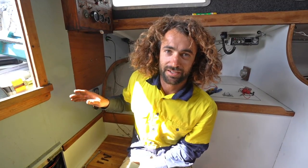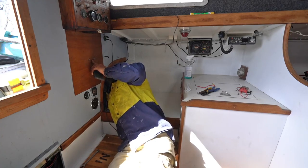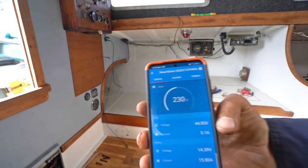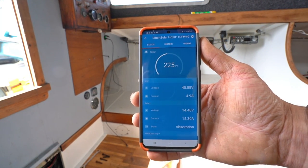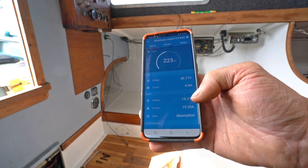We'll just go under and flick the breaker on, so we'll have charge going to the batteries and then we can hook our phone up to the controller and see how it's working. I've flicked the breaker on but I'm not sure what's happened — let's connect to it and find out. I've connected to the charge controller — it shows you how many watts are coming in. It's pretty much full sunlight with a bit of cloud around, and we're reading about 227 watts. It tells you the voltage from the solar and the voltage it's putting into your batteries, and it all seems to be working pretty well. The solar panels are hooked up, the batteries are in, we have power. Now I've just got to sort out the lights and a few other things and we should be pretty right. We can just about start cruising. Thank you all very much for watching and I'll see you soon.